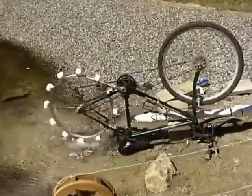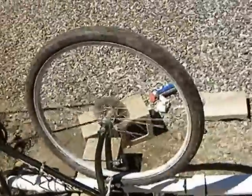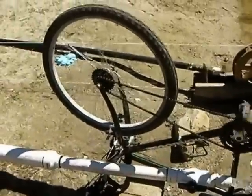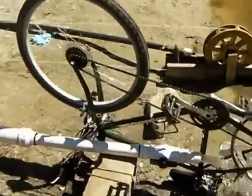As you can see, I'm utilizing the gears on the bike to give me a faster speed on the front wheel. So on the very back rear wheel, I'm using my largest sprocket in the back, going to the smallest sprocket in the middle, and then the chain going to the front wheel goes again to the largest sprocket in the middle and to the smallest sprocket in the front. You can see that the sprocket in the front is actually on a wheel that came from another junk bike I had in my garage or barn.